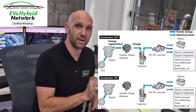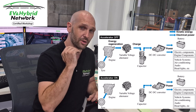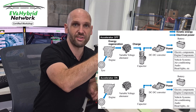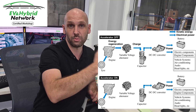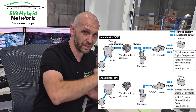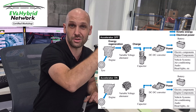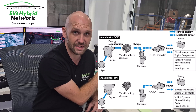There's an alternator specially designed for the job. Whenever we get off the accelerator — we don't even have to be braking, just decelerating — we turn that alternator on to full effect and it's able to output its 25 volts. While we're decelerating, the wheels are turning the engine, the engine is turning the alternator, so we're using the wheels to turn the alternator to produce electricity and store it in our capacitor.